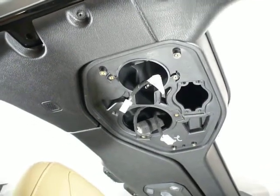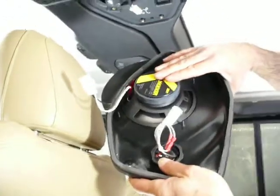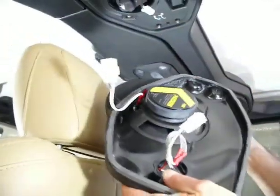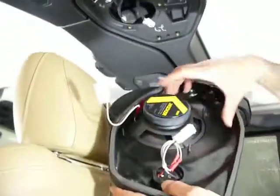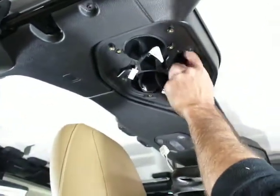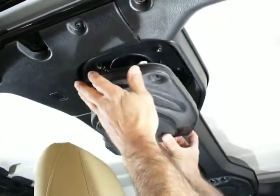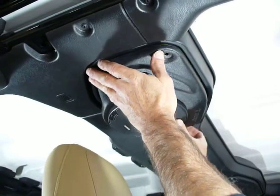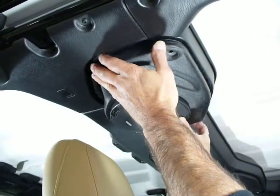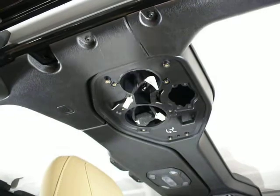The idea behind these pods is that the large speaker has a standard-size magnet, and there's a decent-size hole plus the entire internal volume of the pod. You remove this, you've got air passage here, air passage around the magnet, a little air in here, and when you pop it up in place the magnet drops through into the entire soundbar with room to spare. So there's air passage — that's the design, and that's what's cool: you don't have to cut anything out.